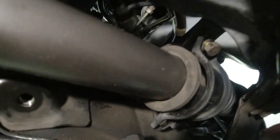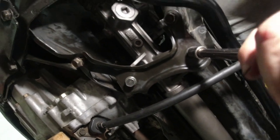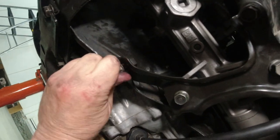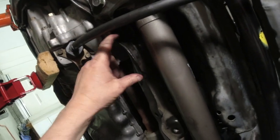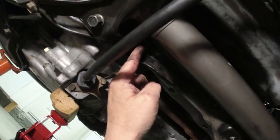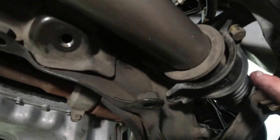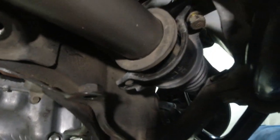Stiffeners, and I've got this bracket loosely, just one bolt in there with the rubber piece, so I think you'll find better luck installing the long bolts here first, and then before they're tight, put in your short bolts next. So there's four. The other one is part of the, remember, the exhaust hanger, the one with the sleeve. So there's no bolt there yet until we get that. So let's get these four tight, and then we'll go over here and tighten the passenger side bracket with the rubber piece.